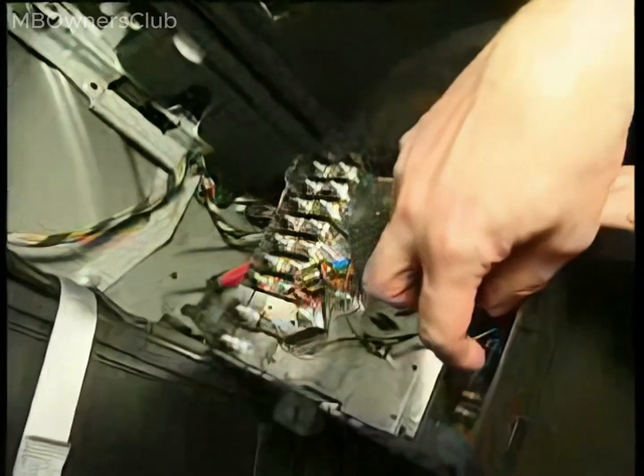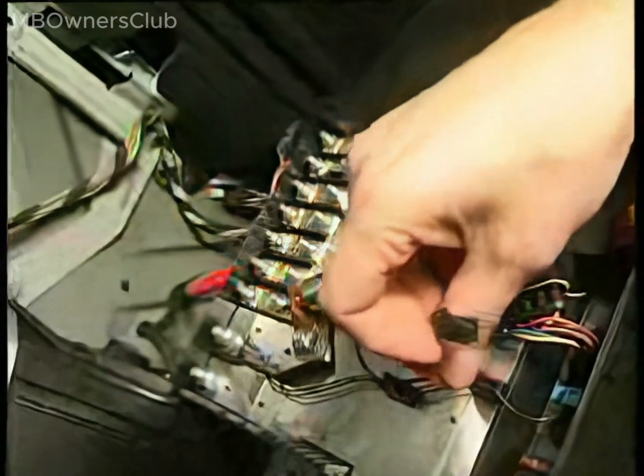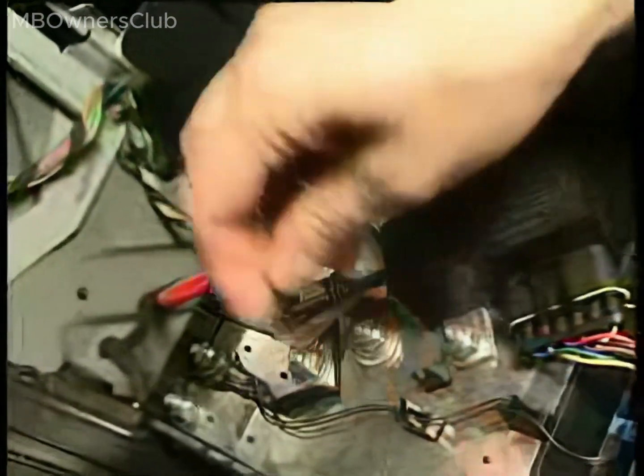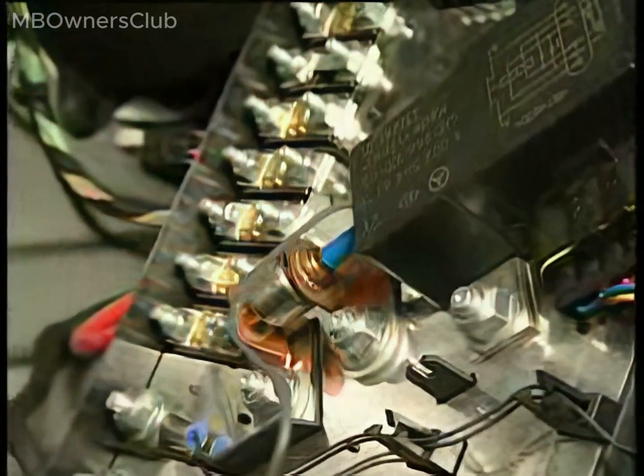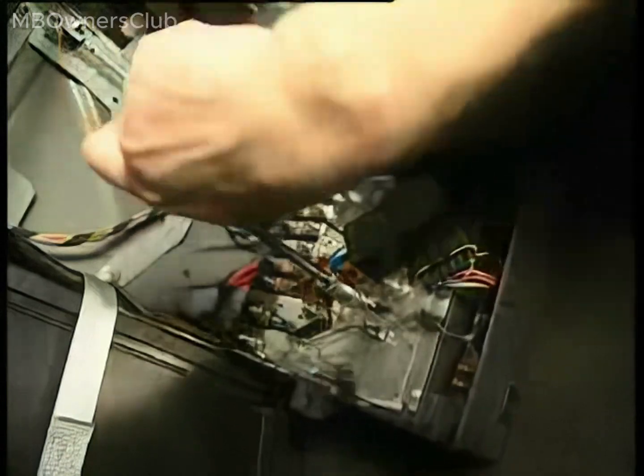Detach and take off the back lid of the Vehicle Power Supply Control Unit. Disconnect the electrical line of the Pyrofuse and release it from the cable brackets. Unfasten the nuts and extract the Pyrofuse from the electrical network line.